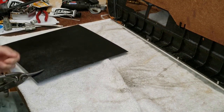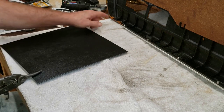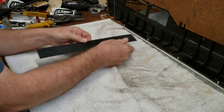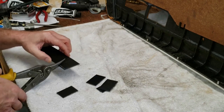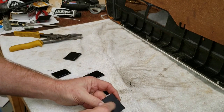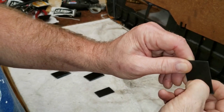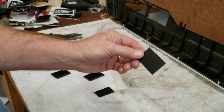Let's start cutting out our new flange — we'll cut a long strip and then cut it into sections, glue those together, and make appropriately sized flanges: one, two, three, four. I've got eight of these little chips. To glue them together I will scuff up the smooth side with some sandpaper and then ABS cement them together. I don't want to glue the textured side — it may not stick. I know scuffing the smooth side sounds counterproductive but that's what I'm going to do.